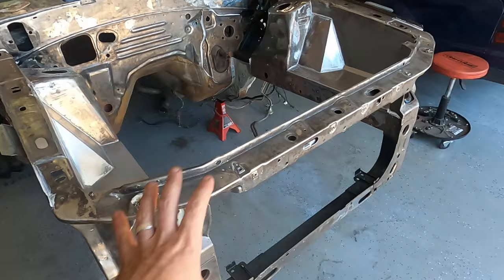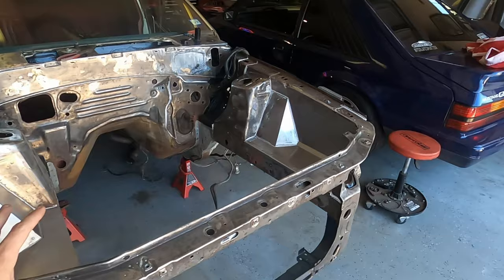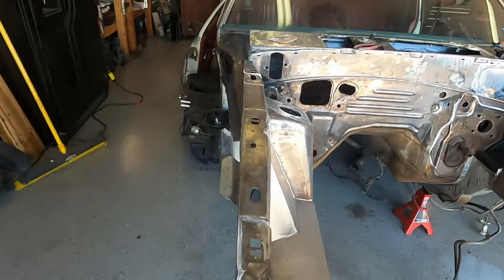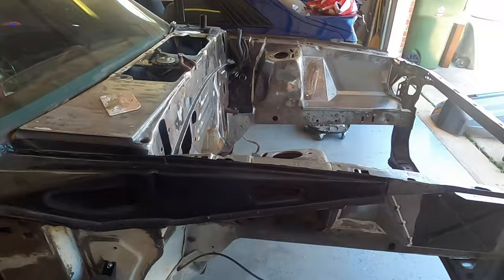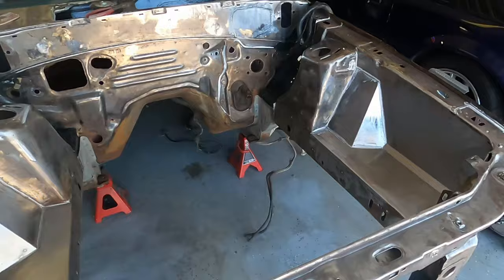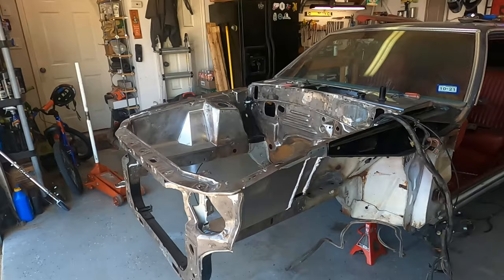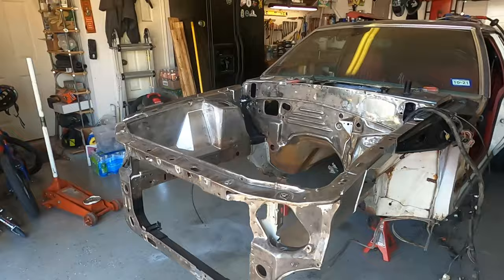The idea here is that the epoxy primer doesn't mean it's sealed and ready for paint. The epoxy primer is just protecting the bare metal, because we don't want to be putting body filler over bare metal. So with the epoxy coat, you can go with standard 2K epoxy or any different type of primer here. But the epoxy primer is a primer that sticks to everything, and it will become the bottom base coat on this car. It is going to be incredibly strong, and everything we put on top of it is going to be strong too, because epoxy is just good stuff.